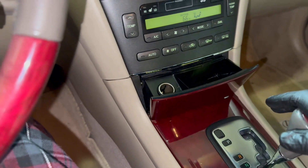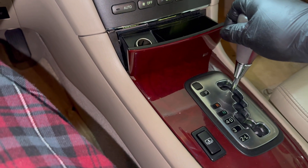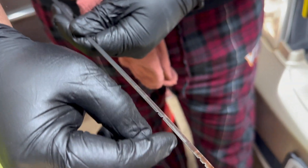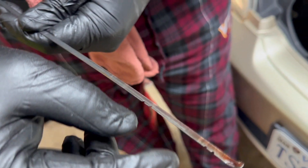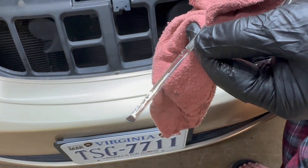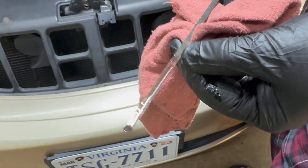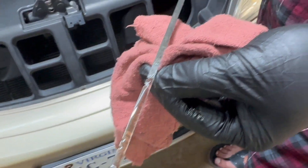You don't need to drive — just hold the brake and go through all the cycles: Park, Reverse, Neutral, Drive. All right, I'm reading here which is almost close to the maximum level — this is the minimum, that's the max. I'm going to add some fluid until it reaches up here. I added the rest of the fluid, and as you can see my level is now at the hot mark. The car is pretty hot, almost maintaining temperature — and that's it.